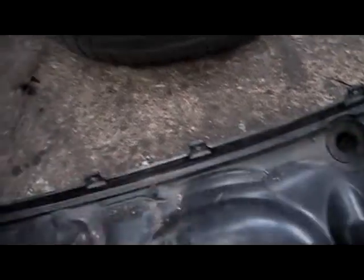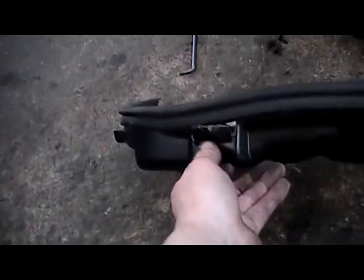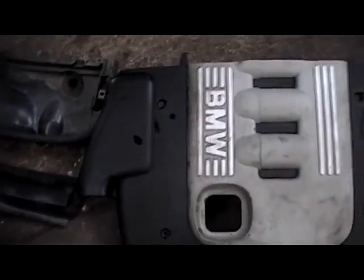To remove the air filter, this cover has come off — plug the air, pop it up, slide it forward. You need to take off the pollen filter cover, undo the three screws here, pop off the wiring loom here each side, lift this tray off, then lift off the top cover and then you can access the air filter.